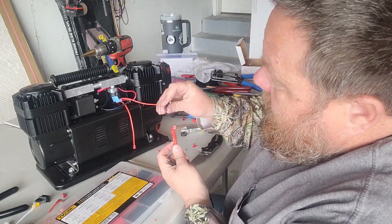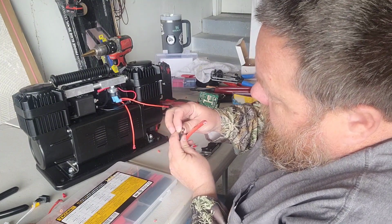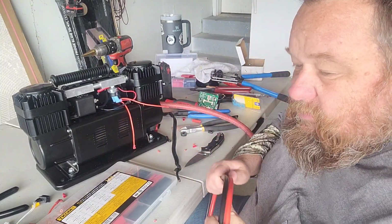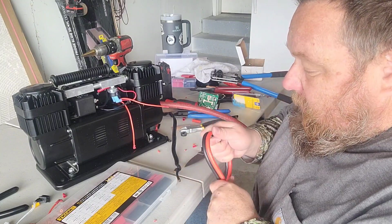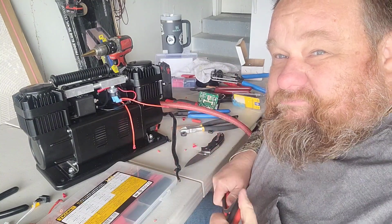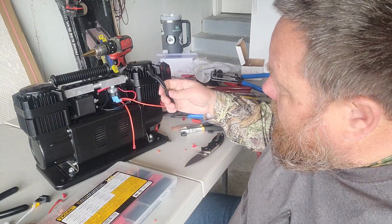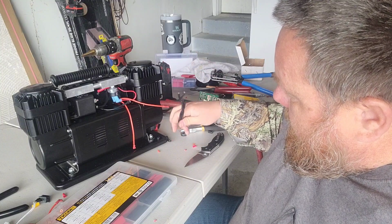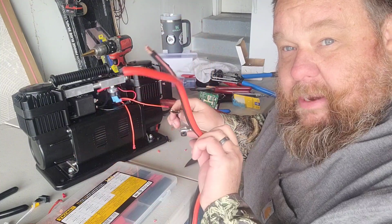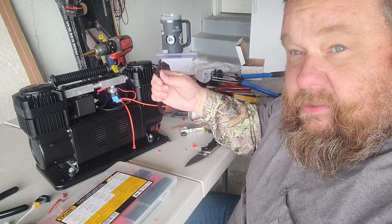But you can see this is the cable that came off of it. It's actually the same size as this jumper cable. So kind of went through making these for nothing. No reason to use these big, thick, kind of heavy, stiff cables when they're all insulation. It doesn't help. So I'm going to go back to this cable here that's a little bit easier to work with. Same amount of copper in this and this. This is easier to work with. So I'm going to go back to using this.